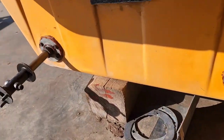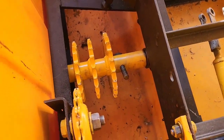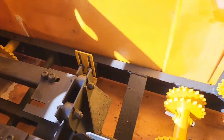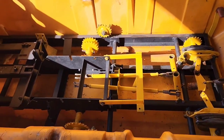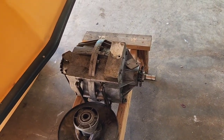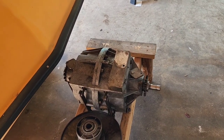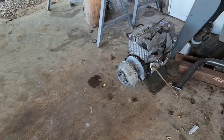Got all six axles put in. They're all lined up. Next, I think I'm going to put the transmission in. Just serviced this, checked all the bands, put Type F automatic transmission fluid back into it — one quart only. I'll be resurfacing the clutch and then soon working on the engine.